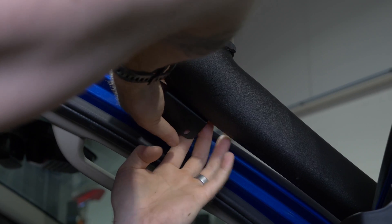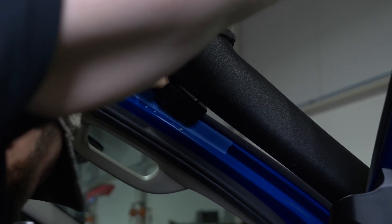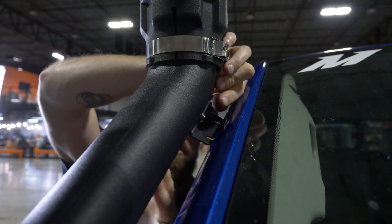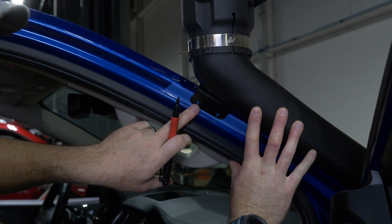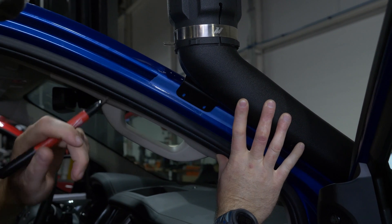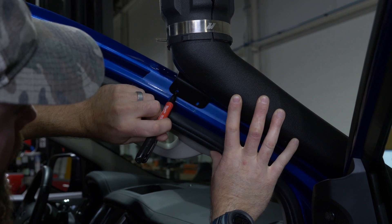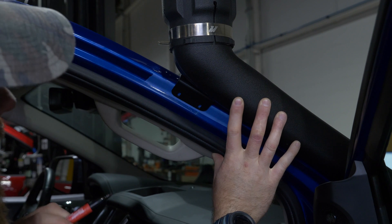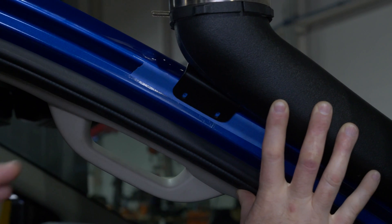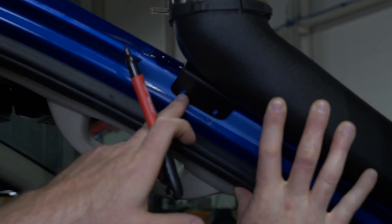Get it going with your fingers and then use an Allen wrench in here to tighten it. You'll notice that the holes in the bracket are slotted — that's so you have some adjustability. I like to mark the center of the slot so that once your rivet nut is installed, your bolt will sit right in the center of these slots and you'll have adjustability both ways.